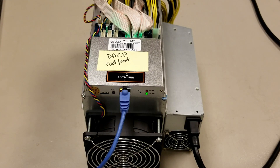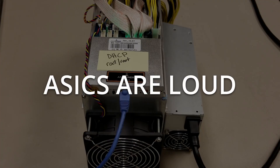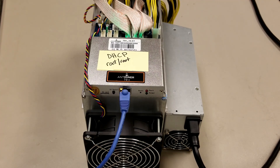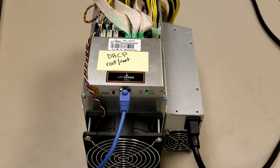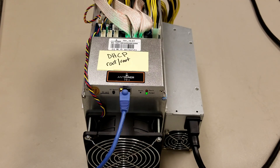Now if you haven't yet ordered your machine, there are a few things you'll want to keep in mind. ASICs are loud. With the fans running at max speed, even the smaller ASICs we are focusing on in this video can run into the 80 decibel range, which is about the same as a hair dryer on high setting. ASICs also push out quite a bit of heat, so putting them into enclosed spaces is not usually an option unless you have sufficient ventilation.